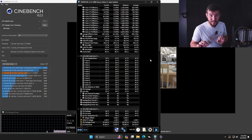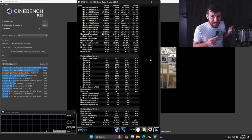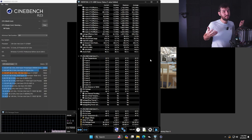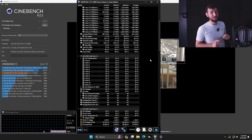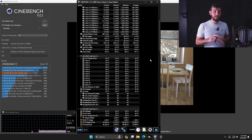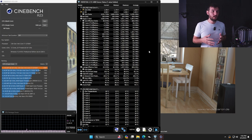Let's start off just like last time with a single core, single run of Cinebench and see how it compares. The first thing you'll notice is the computer is super quiet even while running this benchmark — you almost can't even hear the fan. If for nothing else, that's worth the $18. It does appear to be doing this single core run faster than the last one. The max temperature was only 57 degrees, and we were pulling between 37 and 39 watts for the remainder of that run.